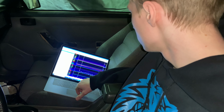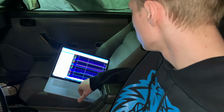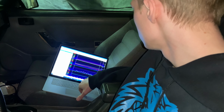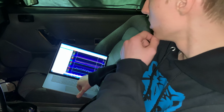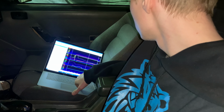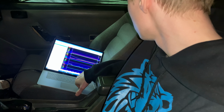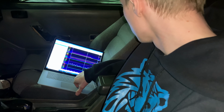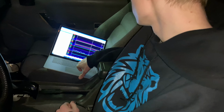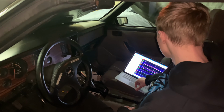Did you hit your target idle there? It's around 1,000 to 1,100, so it's a bit high right now. A little higher than we told it to idle at, 900? Yeah. But did it even come off a cold start idle? Did it settle back down at the end before you shut it off? I mean, it slowly came down, and before I turned it off, it came into the 900. Yeah, so it's on its way down. I just saw the 0 degrees timing and wanted to check that out first.